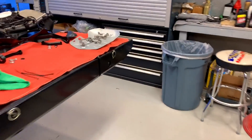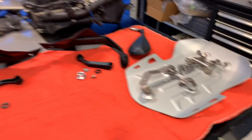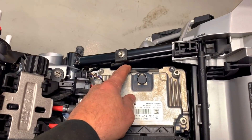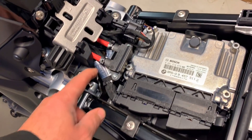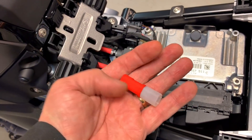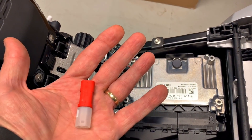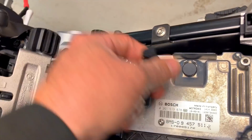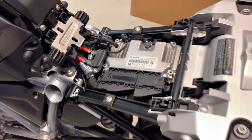I'm finding things here off and on. Number one — look at this more robust skid pan, look how it's all formed around. It's got a different skid pan. And as soon as I popped the seat off, I was greeted with — those goofy inline fuses that were embedded in a harness are now replaced by a fused block. And this big loom right here — where you put the pro chip in — this allows you to have ABS Pro, Dynamic Pro, Enduro Pro, all those cool features. It used to zip-tie into the loom, but now it's got a nice neat little home with a blind plug to keep dirt out. Super nice.